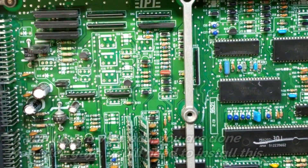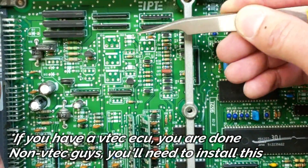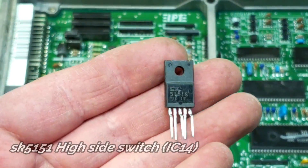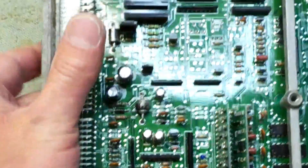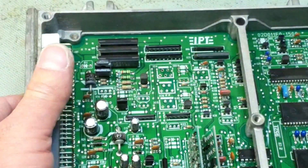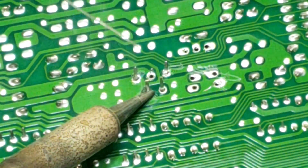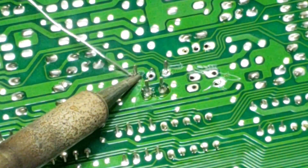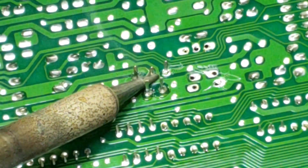You are pretty much done if you have a non-VTEC ECU. If not, here we go — this is the VTEC section. We are installing the high side switch, which goes on IC14 right there. Just showing you guys the soldering technique — make sure that you hold your iron there a second or two longer just so that the solder will flow through to the other side.